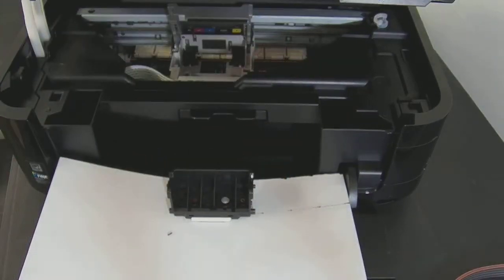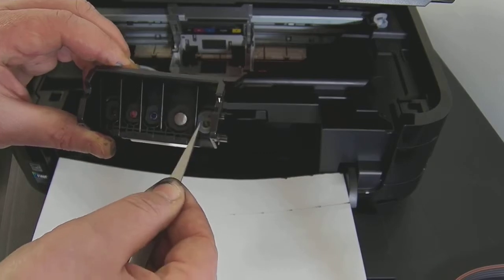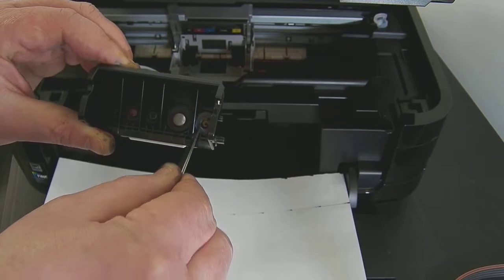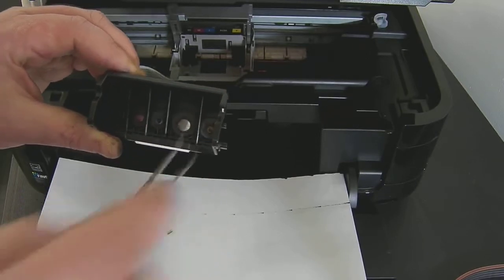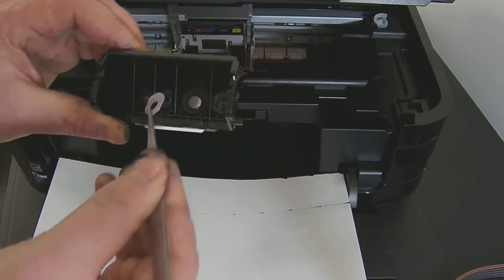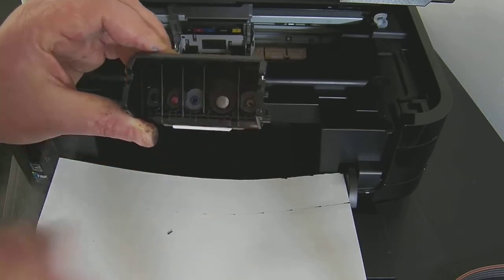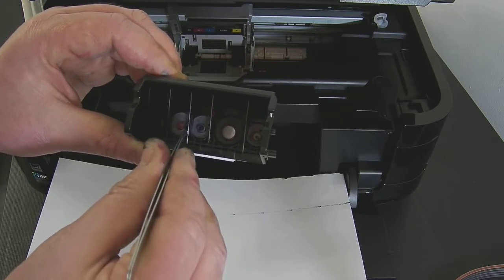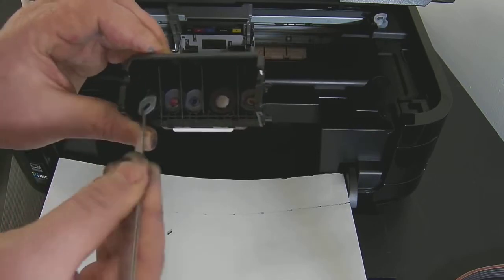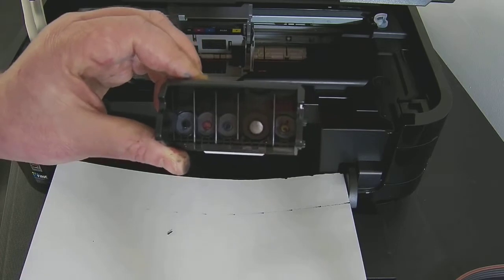Put it on a piece of paper or something similar. Now within your accessory pack you will have some small silicon seals, and what you do is you place one of the silicon seals around the nozzle of the printer — one for each colour. You'll have four small ones and then one large black one of a different shape for the large black cartridge. Try not to touch the metal nozzles at all. Just use the tweezers provided in your kit and smooth the silicon seals on straight around, making sure that they're flush.